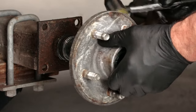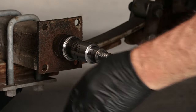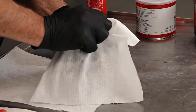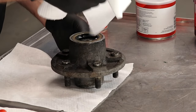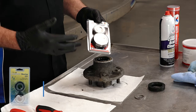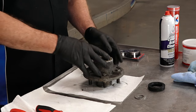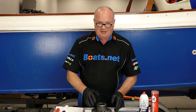Alright, she is off. Let's take the hub and our outer bearing over to the bench, get it completely pulled apart, cleaned up, and then repacked. We just need to pry out this seal and take a look at the bearing to see if we can repack it and just put in a new seal along with a new washer, or decide if we want to go ahead and replace the bearings, the seals, everything with a kit. So I'm going to carry this over to a vise, clamp it down, pop out that seal, and then we'll take a look inside.